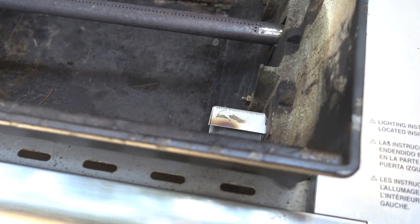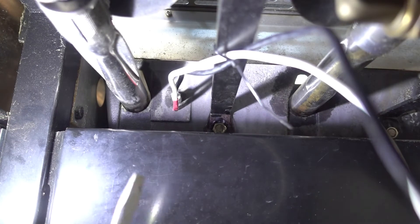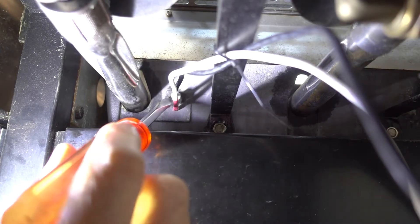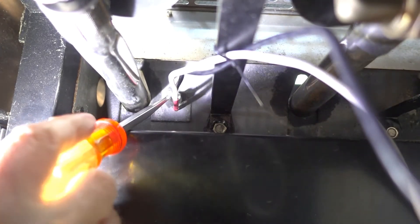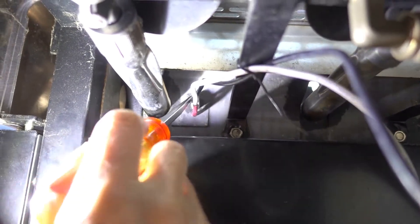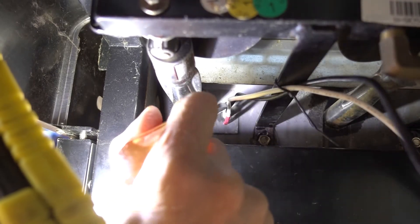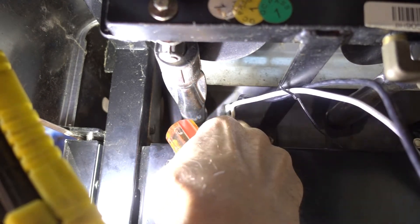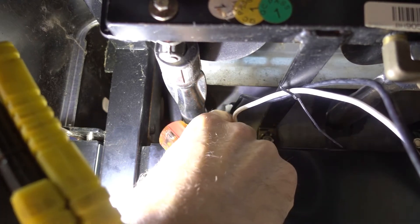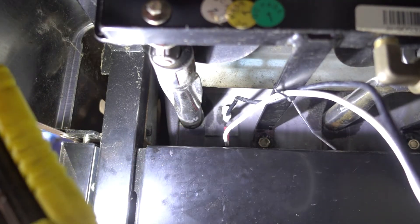Let's shut them off. I'm going to prepare the grill. Don't forget to bend that sheet metal tab that comes through out of the firebox — I'm going to have to push that up so the igniter doesn't slip out. Just like that. This bottom white wire terminal was bent down a little bit too — I think that helps hold it in as well.